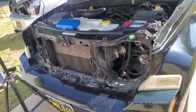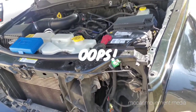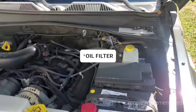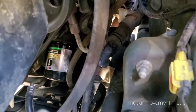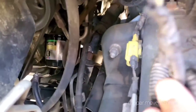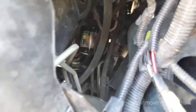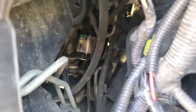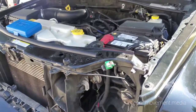Both lights are off — we're ready to get back in business. But this is the point where you get to it when you want to change your oil filter. Now you've got the vehicle up, oil is drained. The oil filter has to be reached from here — can't even see it otherwise. You have to by hand get this headlight off so you can get in there and do what you've got to do. We just did an oil change so I'm not going to do it right now, but that is the way to go. Future reference — another tip for your uncle Willy.